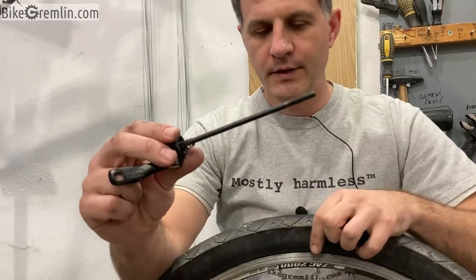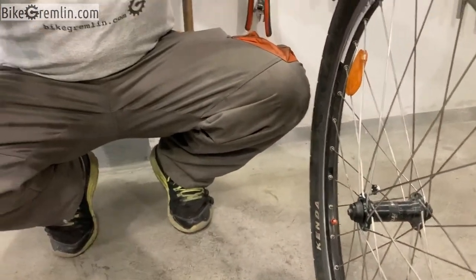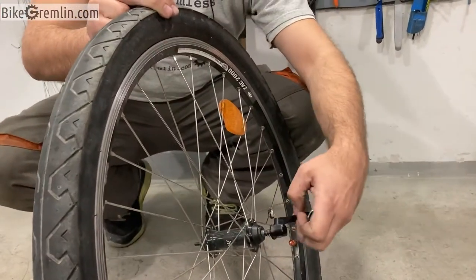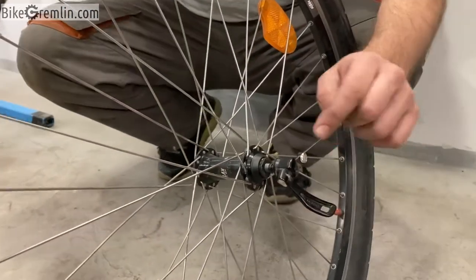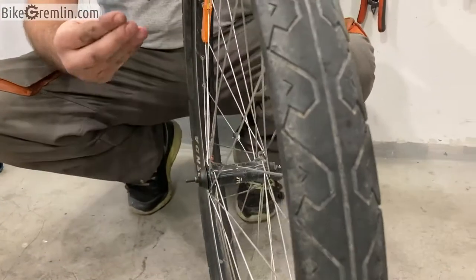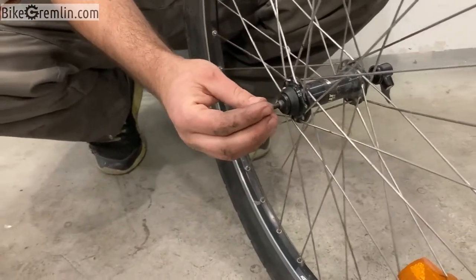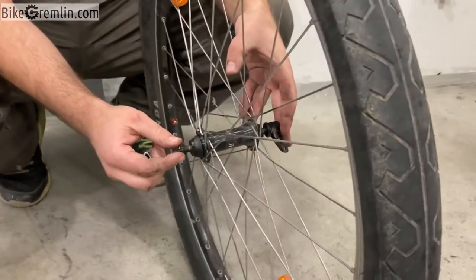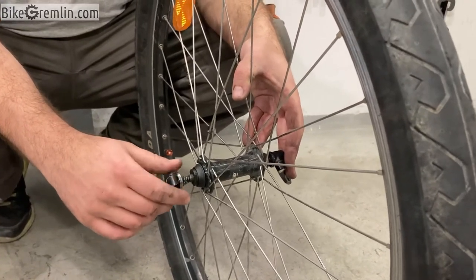The first thing I would do is insert the skewer into the axle, which is hollow. This part usually goes on the left-hand side. I'm putting the lever in the open position — the lever has closed and open positions, we'll talk about this a bit later. On the right-hand side, I'm again paying attention to insert the spring properly with the wider part to the outside. I'll push this end to make the lever protrude a bit and screw this on just by a few turns to make sure it's tight and safe. Now I can try to mount the wheel.